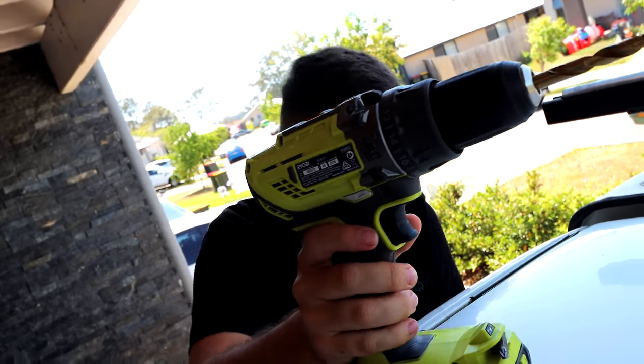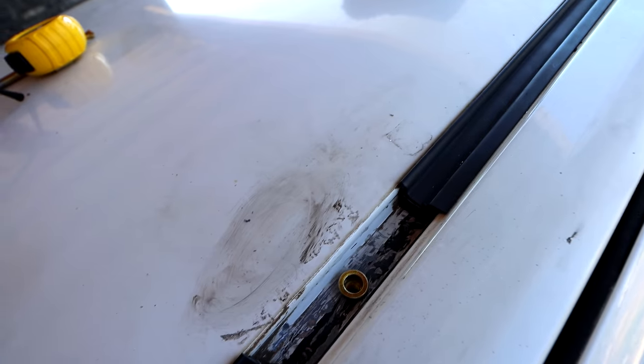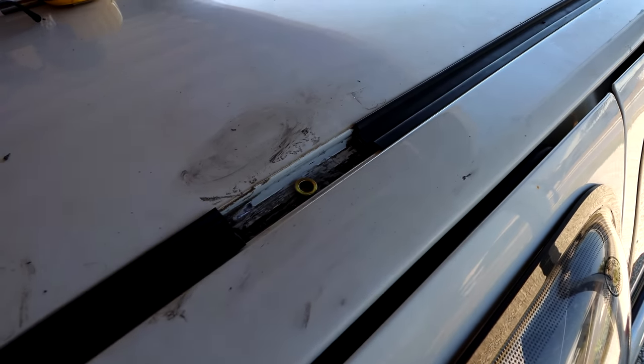That's the biggest hole we've had — as soon as I saw the drill drop straight there I knew we were screwed. So we've got that big one and a tiny little hole up here, but the other two are sweet. The way this attaches is just a few little riv-nuts — nothing crazy. We've drilled out a 9mm hole and the riv-nuts fit in nice and neatly. We'll quickly vacuum out all the swarf, then put some silicon around the hole, put the riv-nut in, and bolt up the rest.